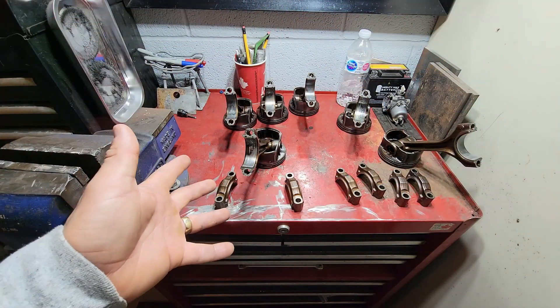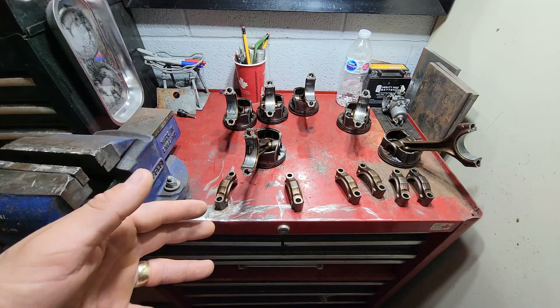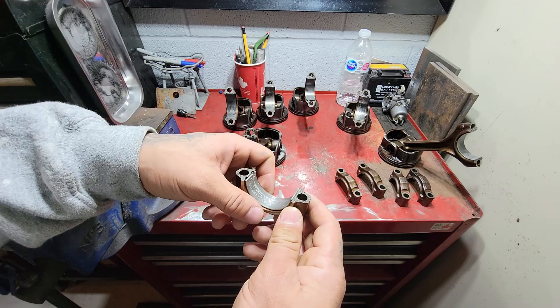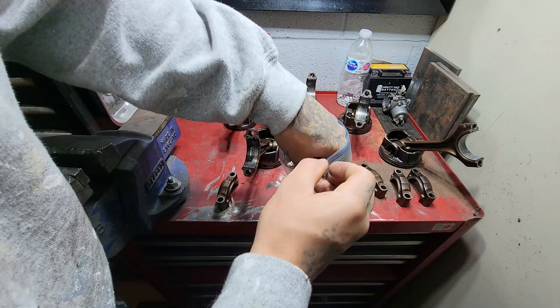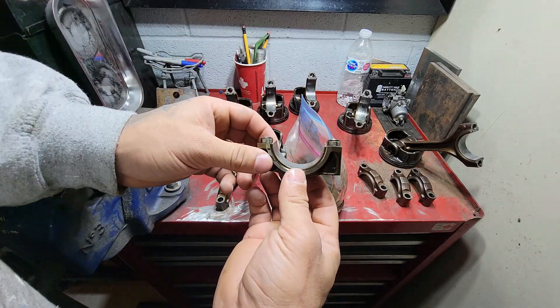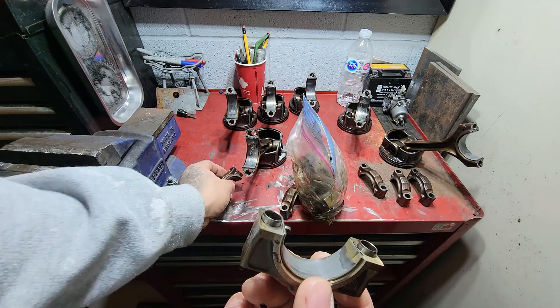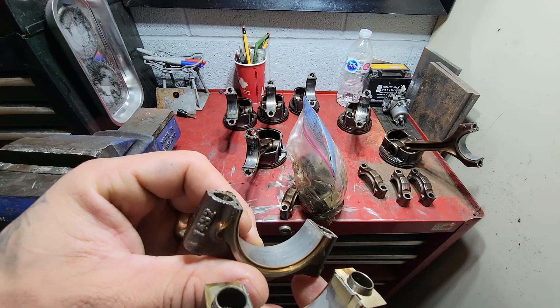So the most bizarre thing I've ever seen — the 3 liter has pistons and connecting rods that are completely flat on the B30. Here's the bottom of the connecting rods for the B30 — you can see how it's completely flat, it's a machined surface. But the B25, I'm not sure why, but they're jagged — and all of them are like that.